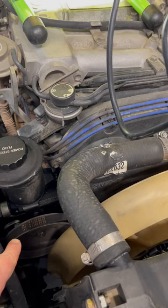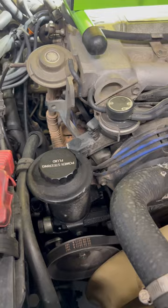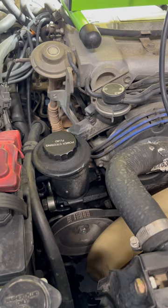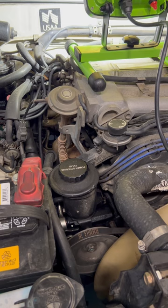As you can see right here, the power steering fluid reservoir is right here on top. The power steering pump is down below. So what I need to do is come in here, loosen up certain straps, get the pulley undone, undo the hoses, remove the power steering pump, take the reservoir off of the pump and put it onto the new pump, reverse the process, flush the system of air bubbles, and put everything back together, and we should be good.